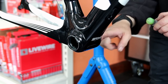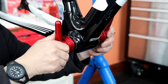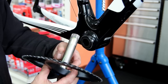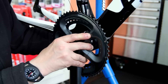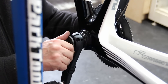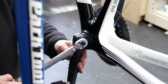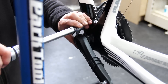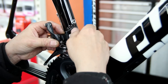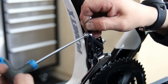Now we pump the tyres up and move on to getting the new bottom bracket bearing in before refitting the chainset. We've got a lovely little press here which just glides the bearings in - a little bit of grease helps them seat centrally within the bottom bracket itself. A little bit of grease on the chainset to help it slide into the new bearings as well. A little bit of pre-tension on the pre-tensioner before torquing up the pedal arm bolts. We like to get the chainset spot on before putting the front derailleur on so that everything is in its final position for adjustment.